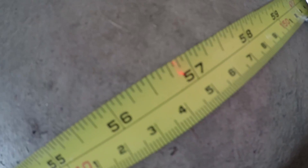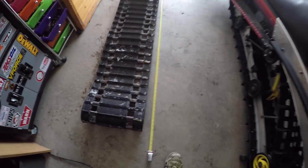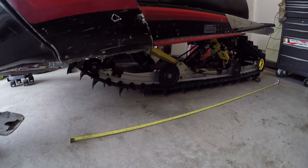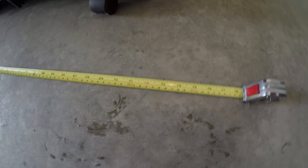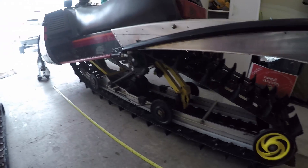So what I've got is the old Phaser track here all laid out. I have my tape measure at one end, and if I were able to push it down flat and carry it down all the way to the other end, it comes out to about 57 inches. So I know that this track is a 114-inch track, which is what a lot of the '86 Phasers came with. This track is basically garbage to me — it's just no good anymore. This is something that's not quite as easy to tell on an installed snowmobile track because of the wraparound in the drivers and your idler wheels in the back, as well as any arches that the track takes.